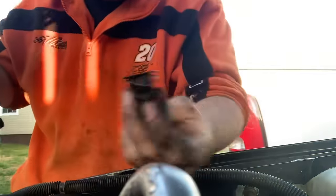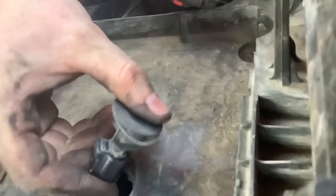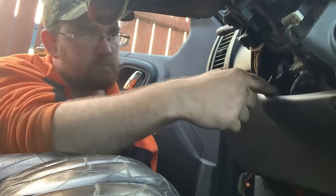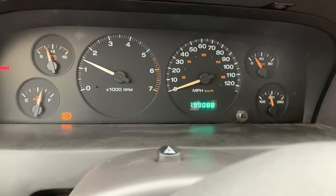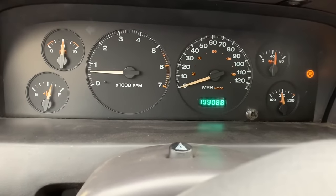Don't forget to put your sensor back in. Basically, all you do — I'm just going to throw this chipped key over in the corner; I'm not going to need it. I can use these keys that don't have chips. Let's go ahead and fire it up and see what it does. This key should actually start the Jeep — it powers up, everything's good, and it starts. Now here's the catch: this key light is going to kick on in a minute because your computer is looking for the SKIM unit. Give it some time — there it is.